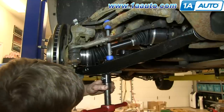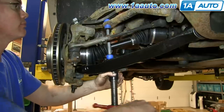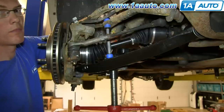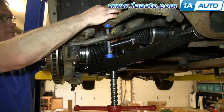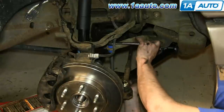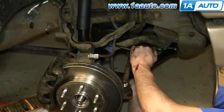Here, we just put the jack underneath the link. That's just to push it up through and compress the washers a little bit so that you can get the nut on the other end. Once I get the nut on, you'll see I just release the jack. You want to obviously be supporting the vehicle with jack stands. Then use your jack to push the bolt of the link up through. Tighten up the sway bar link until the rubber bushings are compressed enough so that they're the same diameter as the washers.